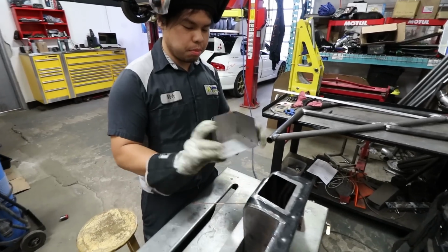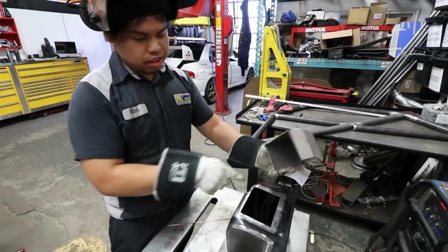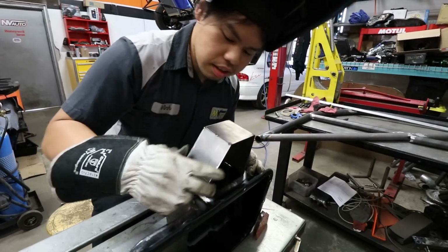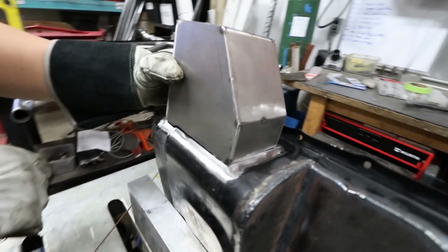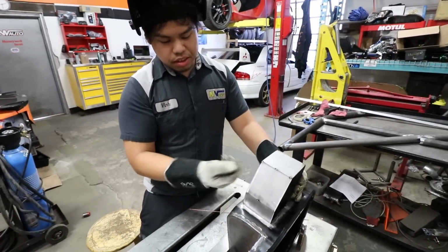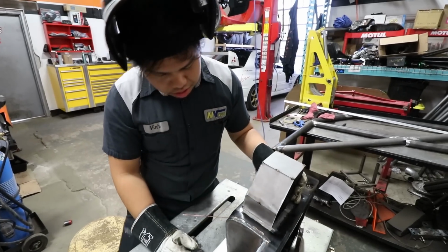So now we got most of our box put together using the cardboard template. We're gonna get this fitted to here. So what we did was we measured pretty much exactly where this would fit and cut it out. The little things, like getting the contour you got here, that perfect fit, make it really nice. It just takes some extra time, but if you ever have gaps or whatever, just take a marker and run it through wherever the lines are. It's an easy way of contouring it yourself and just shaping it.